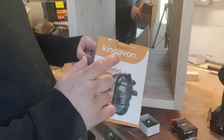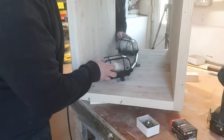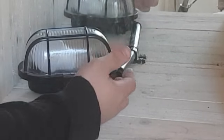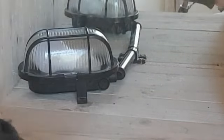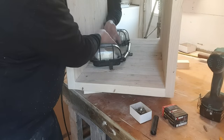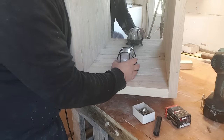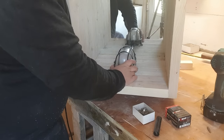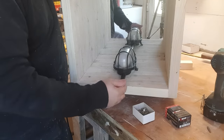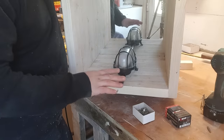I've redone the light - these are bulkhead lamps, this one's from Amazon, I'll try and put a link in the description. There's a rubber grommet in the bottom to keep everything watertight. I've super-glued it to a piece of piping. I've put the bracket right at the front to hide the join towards the mirror. Pushing it together and screwing it into place, leaving the top piece oversized for now since I still need to route around and get the glass.